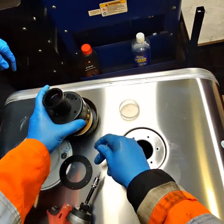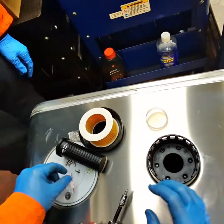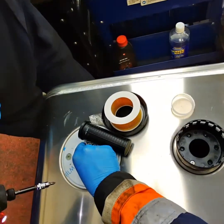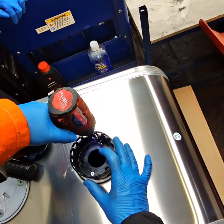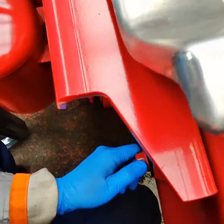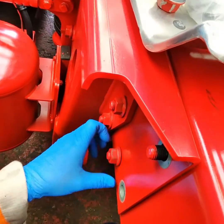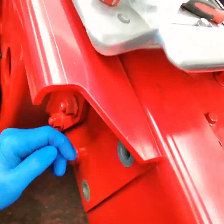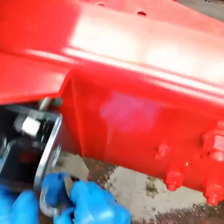We can now fit the filter — and try not to throw the bolts into the hydraulic tank, as that's fun getting them out since they're not magnetic. To mount the tank onto the chassis we need to relocate some bolts and change the top bolts from the shouldered DAF bolts to normal bolts, as the tank strap pin design means I can't get the pins through the strap with a shouldered bolt. Well done to whoever came up with that idea.